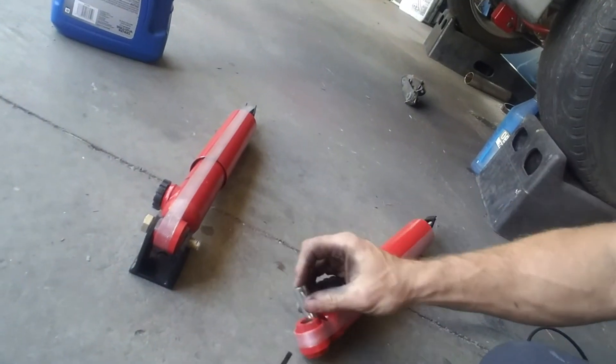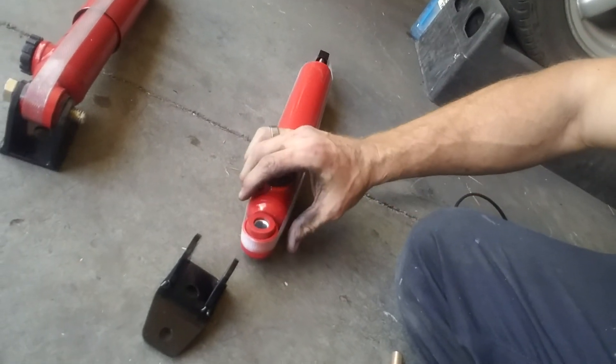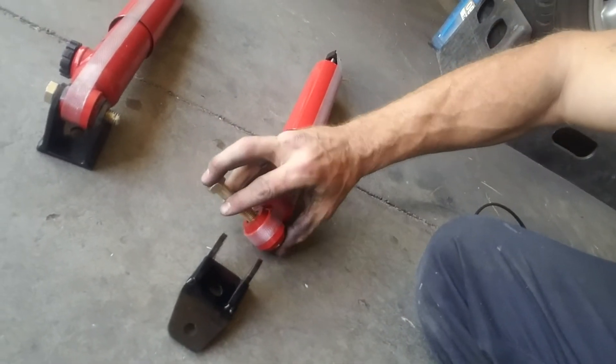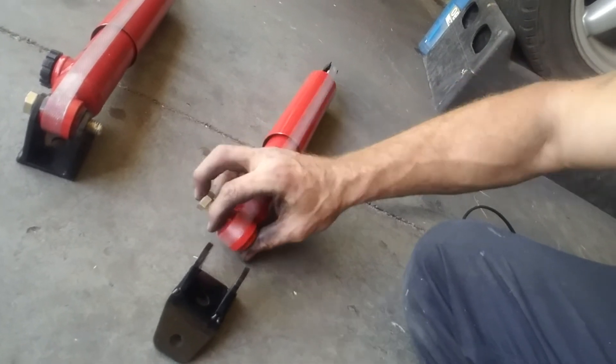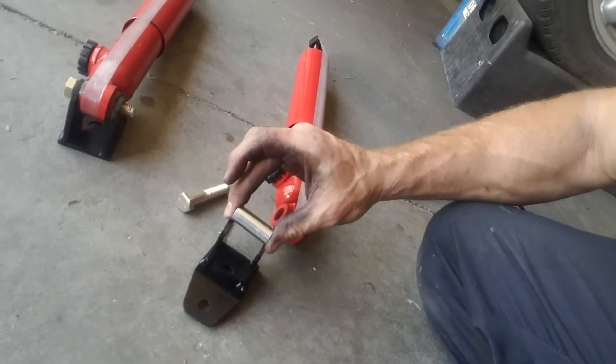What I've found is a cheap little fix you can get from your local hardware store. You'll find this little sleeve — the part number for it is 59657, it's a half inch by five-eighths by one and a half inch sleeve. What this sleeve does is you slide it in here like this, so that way it takes up the slack, you get the bolt in there, and it's good and tight. Problem is, you still have to take about a quarter of an inch off of that sleeve so that it'll slide in. Very simple — if you've got a Dremel tool with a little cutoff wheel, it's very, very easy to do.